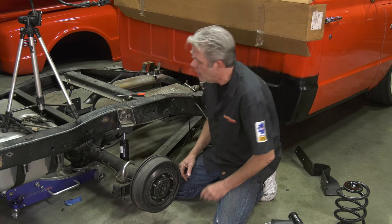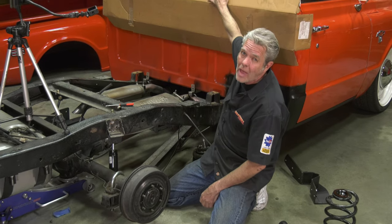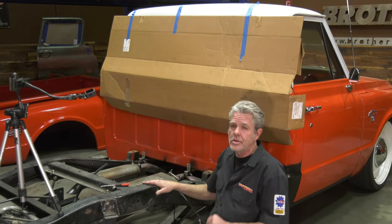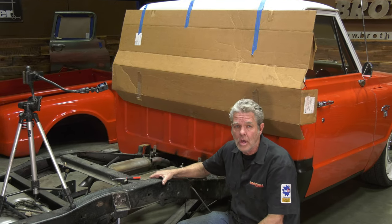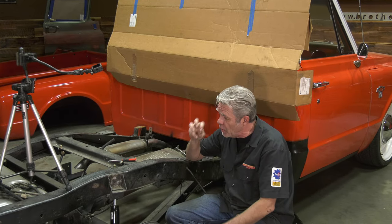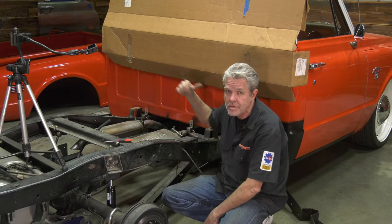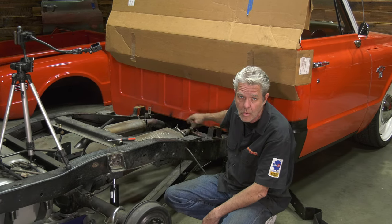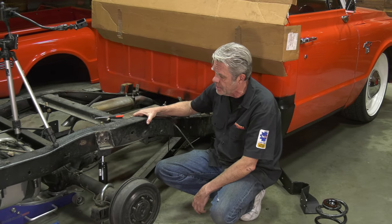A couple other things you're going to want to do at the same time is make sure that your glass is protected. You might be thinking to yourself, well, I'm not going to get any sparks on there or anything like that, but you'd be wrong. And when the sparks hit glass, they burn right in. They'll burn into your paint too. If I wasn't going to be painting this, I'd make sure that this was covered too. But I don't have to worry about it. I might reuse that glass though, or find somebody else that might be able to.